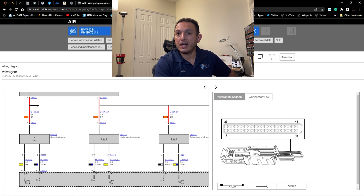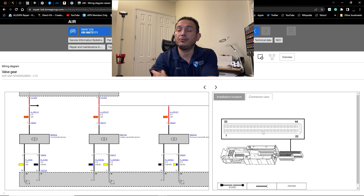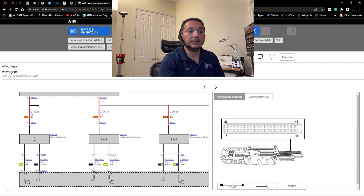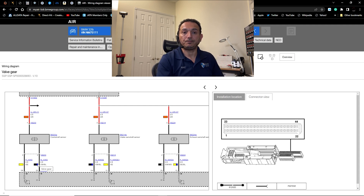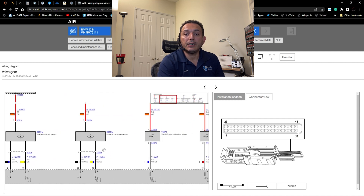The pins are very small and it can be hard to see exactly which wire you're on, so follow wire colors. For the crank sensor signal it's the yellow wire at pin 29, adjacent to the black-with-blue at pin 30. That combination confirms you're at the correct crank sensor signal pin.